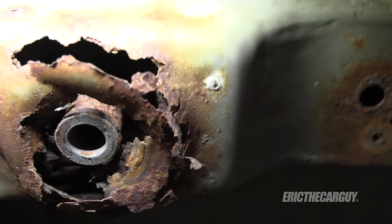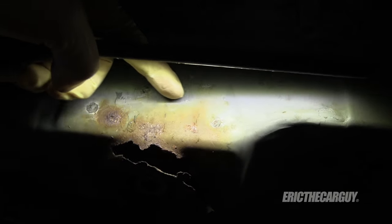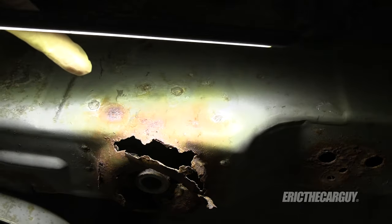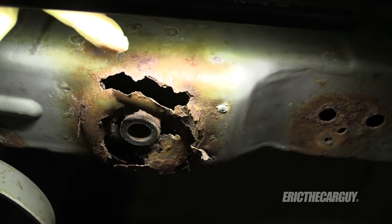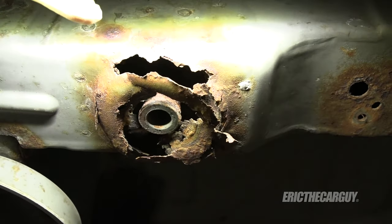I've done some poking around and pulled this open a little bit more. It's actually secured further up where these spot welds are. There's a plate up in this area that the center piece — the one the bolt goes into — attaches to. I kind of want to preserve that. The damage around the outside is almost cosmetic; the plate that holds the fasteners up inside is the structural element. So I'm going to start by cutting around this area to observe the damage, and I may end up cutting the entire thing out and rebuilding the outer structure to support the inner structure.